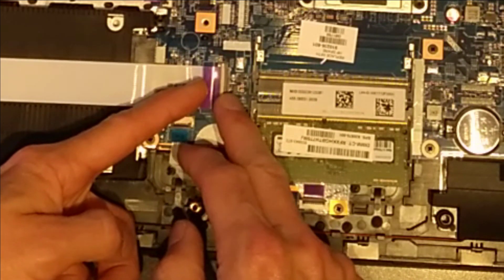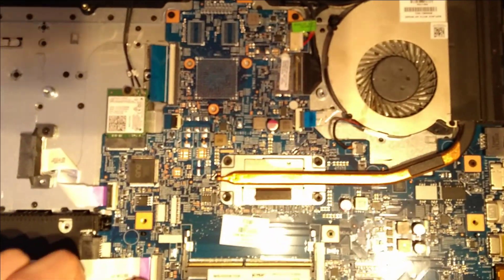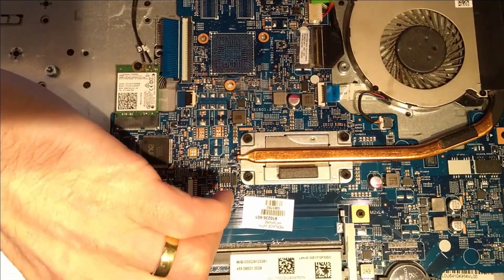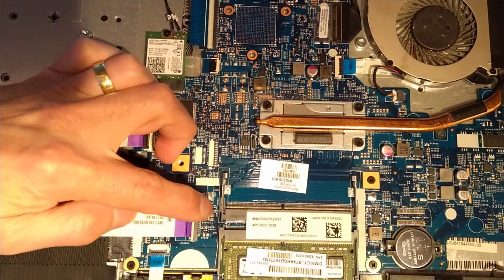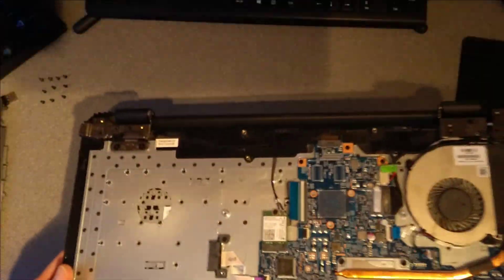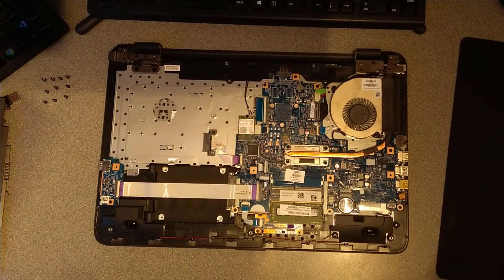That's now securely pushed into the connector. I'm going to hinge the ribbon cable connector downwards this time, and if you've done it correctly there should be no massively visible black strip where that connector is. If you can see that black line running across the connector, close it back up whilst making sure it's securely in place — the white connector should cover that black strip. So if that black strip is wonky or not fully in and you can still see some of it, have another go at reconnecting it.